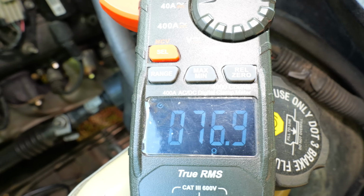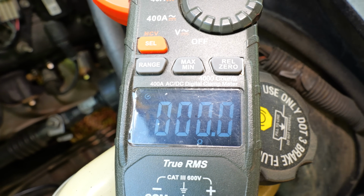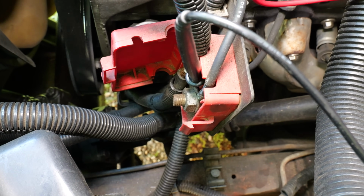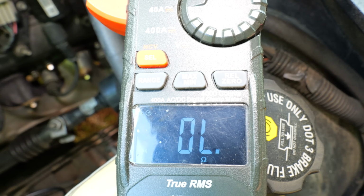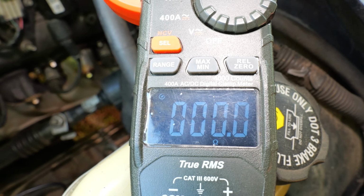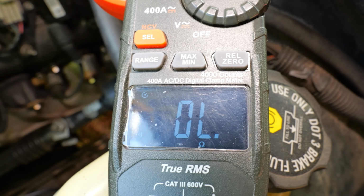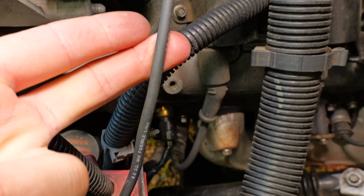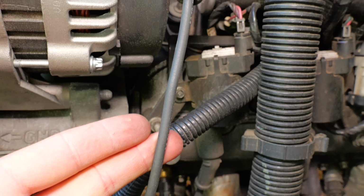So if you think that's the problem why your truck's not charging, you might want to check it with the multimeter. Make sure you have continuity on that Fusible Link. But if that link's good, you should be charging, no problems. So y'all know I had to show you how to test it. Broke out the multimeter, come up here, one probe right here, one right down in there on that Fusible Link, and touch it. Hear it beeping. We got 0 ohms, just like that. Means we got a good link. If you didn't hear any noise, or if it was just open, means your link's bad, and I would recommend getting a new one, because it's probably why your alternator's not charging.